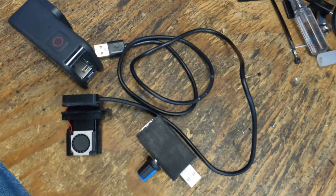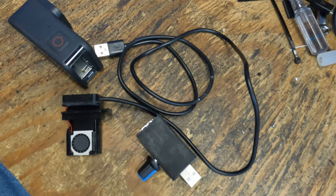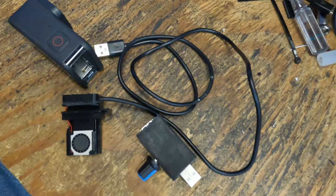Welcome to the shop, Hero 10 owners. We have a couple of Hero 10s ourselves and we are plagued by overheating in 5K mode. In a hot ambient with the battery installed, forget it — it's not going to happen. We do what most people do: power the camera independently with a battery pack without the battery inside. Even doing that in a warm ambient, once you get over 82–85 degrees, in our testing we were limited to about 30 minutes of recording.